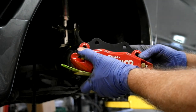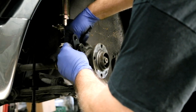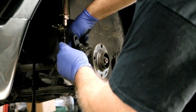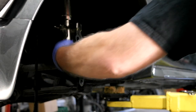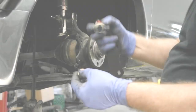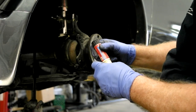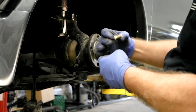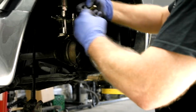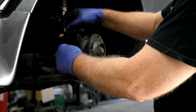You can see there's only one way the caliper adapter can go on — it fits the shape of the caliper. We'll start by installing just the bracket. Inside the package there's blue thread locker; use it on both the caliper bracket mounting screws and the caliper screws themselves. When installing the bracket, try to keep the slack towards the outside as much as possible, both on the bracket and caliper, because clearance is really tight.